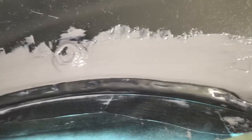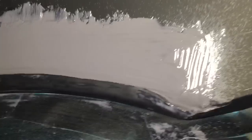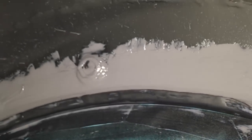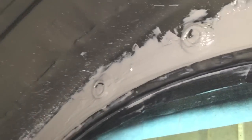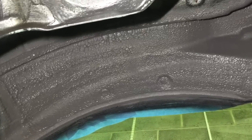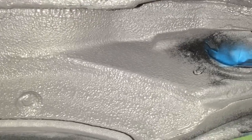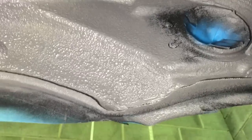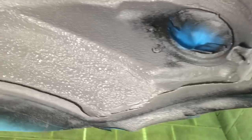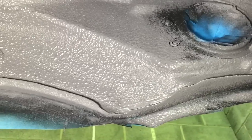We've finished filling the U-channel now and we've wiped clean the excess off the outside of the channel, because we'll do a thin sprayable textured finish on that. We've filled up the void so water and mud can't sit in there and will just wash out rather than sit. Normally we'd do the rest all in one pass, but we're doing this in multi-stages because it's a high-pressure sprayable seam sealer — if we try to coat the rest now it's going to push and upset this section which is curing. So we're going to leave this 24 hours to cure, then finish off with the rest. The sprayable seam sealer's now had 24 hours to dry, it's all cured — happy with the results. I've pretty much lost the join line, and we've obviously seamed the lips in the U-channel and on the back channel so that water and mud shouldn't sit — the sealer's sloped so it should just slide back off.